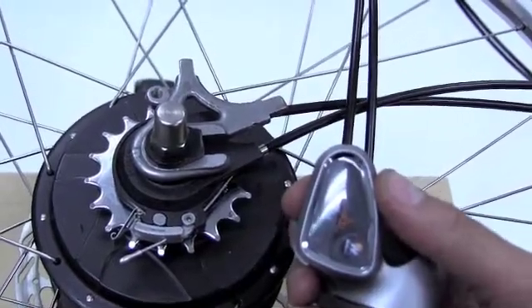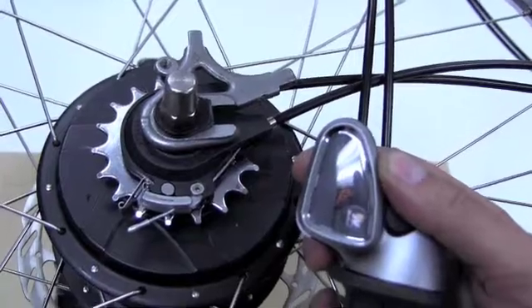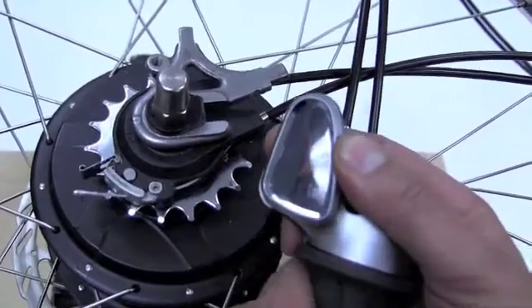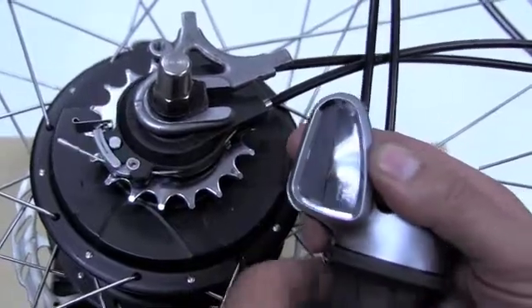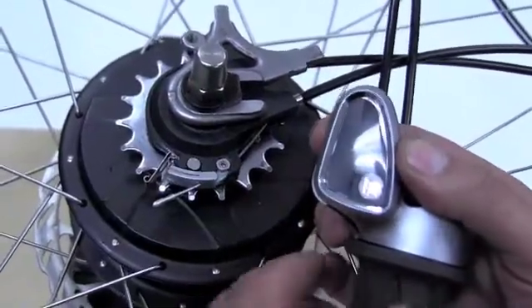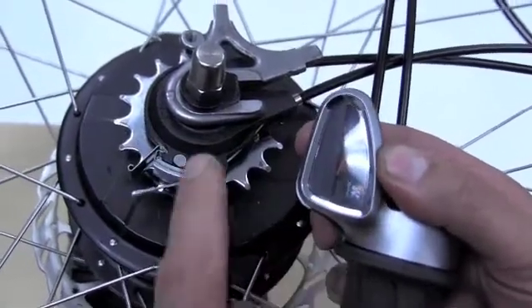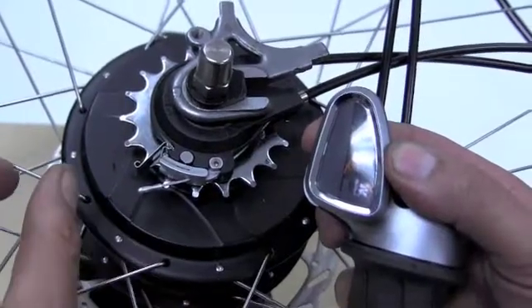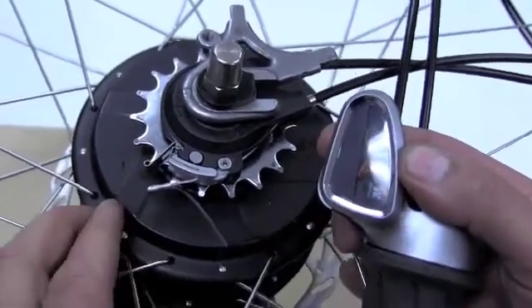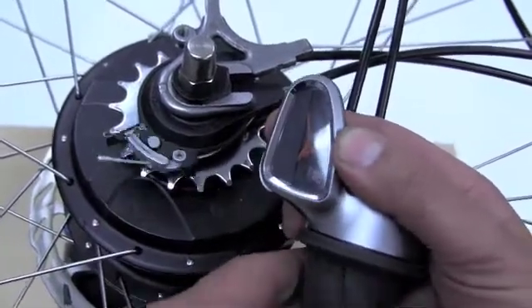Let's have a simulated look at the operation of the cable and shift lever system. The shift lever is rotated going to our underdrive and then our overdrive. It pulls one direction, pulls the other direction. It's rotating the hub interface, rotates that inner star ratchet. That changes the idler and our gear ratio. So that is how the shifting takes place.